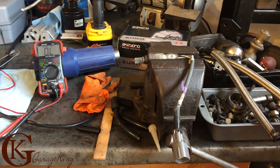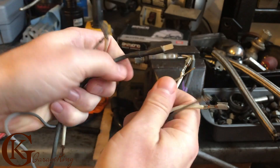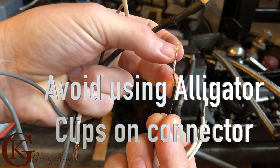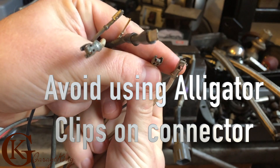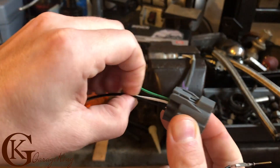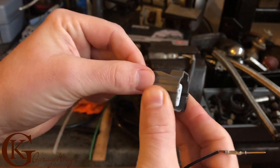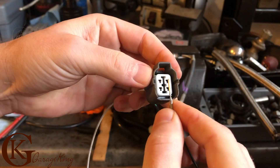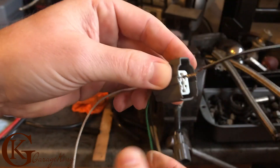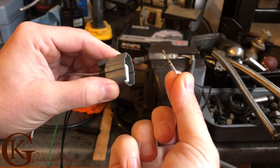Firstly, what I do when I'm testing all my connectors — I have made up a bunch of things like this. This is to avoid using alligator clips. There are different types of automotive connectors; this one here is almost like a pin, very narrow, and these things slide on. So say you want to hook up the white wire — I look to the rear of the connector, put my little pin in just like so, and there we go. I haven't stretched or damaged anything, and now I can connect this to my multimeter.